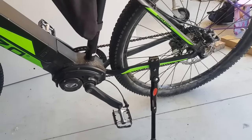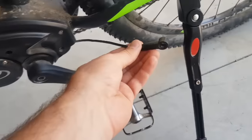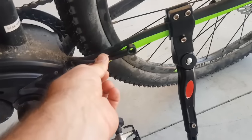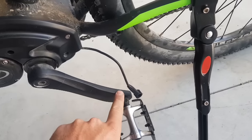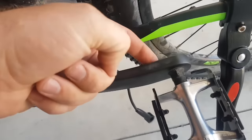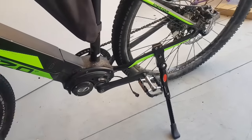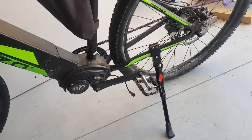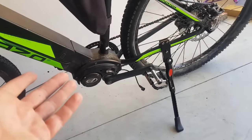Unfortunately I can't do that on my e-bike, so I'm going to show you how to trick it another way. What we're going to do is remove the sensor from here and put it on the outside, about here, and then mount the magnet to the crankshaft. Every time the crankshaft passes the sensor with a magnet on it, each pedal stroke is going to register as a certain speed, which will be incorrect — much slower than I'm actually going — because one pedal stroke does not equal one rotation of the rear wheel. The speed limiter will effectively be rendered obsolete.